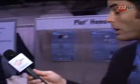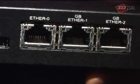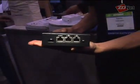You can't add a compact flash to this model — that's what the USB ports are for. It runs the same Linux operating system as the other one. So to summarize: it's faster both in terms of the processor, the Ethernet ports support gigabit speeds and Power over Ethernet, but storage must be added externally through the USB 2.0 ports.